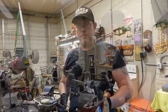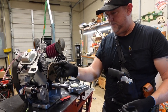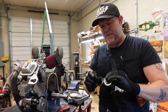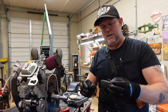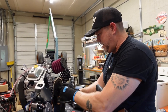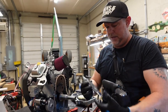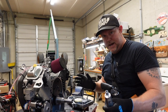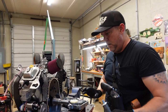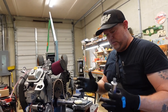What this kit provides is two shims — one for the camshaft, one for the crankshaft. These are the stock ones right here. My micrometer batteries are dead so I couldn't mic the thicknesses, but as long as it works, I don't care. These are the ones from Performance 670. What they do is make up the difference between the gasket that was on here and when you use this RTV. So we're going to take some acetone, wipe down the mating surfaces, make sure all the old material's off, and bolt it back on. When we're ready, we'll read the instructions — there's probably some kind of setup time.